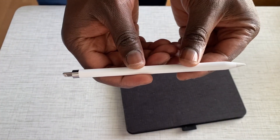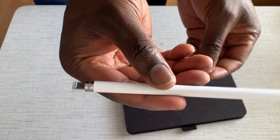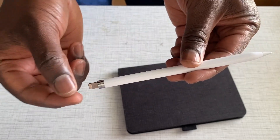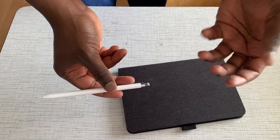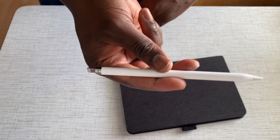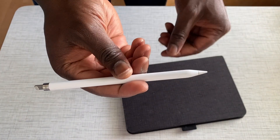I found out why it's doing this. It's because the Apple Pencil is designed to work with a little bit of charge in it. So when you see your Apple Pencil charge down to zero — when it's low battery and down to zero — it's not really down to zero. It's got a little bit of charge left to do all the connections, syncing, and kick off charging. Unfortunately, sometimes you can leave your Apple Pencil completely unused, maybe for months, and it charges down to absolute zero. The battery is completely flat.